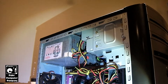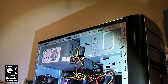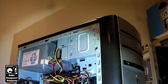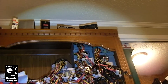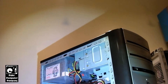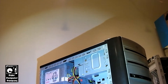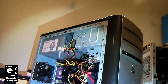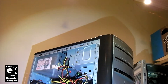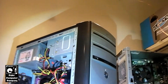This E-Machines system has parts that are not original. E-Machines did have their issues, particularly with the power supply. The Bestek ATX-252-12E had a defective 5-volt standby design, and when the capacitors failed — not if, but when — the power supply would self-destruct and take the motherboard with it. That was a big problem for E-Machines back in the day. They were otherwise great computers with a solid case and a solid platform that you could upgrade and do all sorts of stuff with.